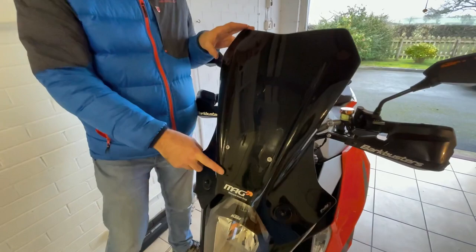The other problem was that road grit and oil from the chain were getting flung onto the disc. I know that's an issue with bikes that have single-sided swingarms and inboard discs, but I was finding the back brake was virtually unusable — particularly holding it on a hill at traffic lights, it just wasn't working no matter how much pressure you applied. So I made this disc guard — I started with a cardboard template until I was happy with the shape, then had a friend profile it out of four-millimetre-thick stainless steel. I've covered it with carbon-effect vinyl transfer film just to make it look the part, and it seems to do a good job — I'm not getting any pickup of grease or dirt onto the disc.